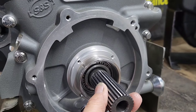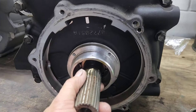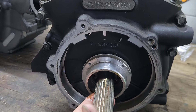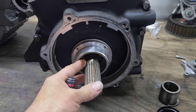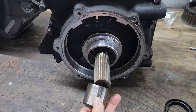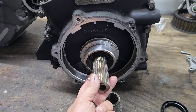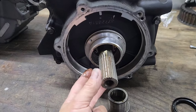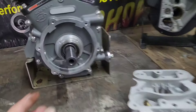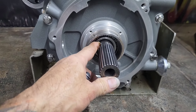On this one here, I like using these because you get the opportunity to dial in your crank end play — that's the movement that goes back and forth. Over here we have a Screaming Eagle 110 motor, and you can see how the crank moves back and forth. Once you install the washer and the compensator, it takes all the end play out, but you really don't have much way of dialing it in and getting as close as possible to spec. On a motor with the Timken conversion, you'll be able to dial it in much better — I think this one's end play is between one and four thousandths.